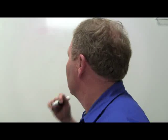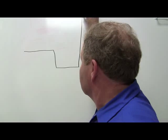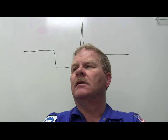When looking at a solenoid with an oscilloscope, what often follows applying or removing power from the coil windings? Diode ripple is what you get out of an alternator. You remember on the scope — you've got 12 volts, he pulls the ground, that's your pulse width, and when you release it you're going to see a spike of about 50 volts. Number 21: explain the engine-off natural vacuum evaporative checking system — natural vacuum leak detection.